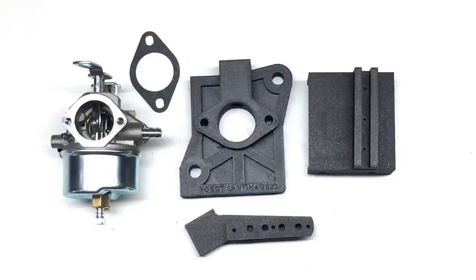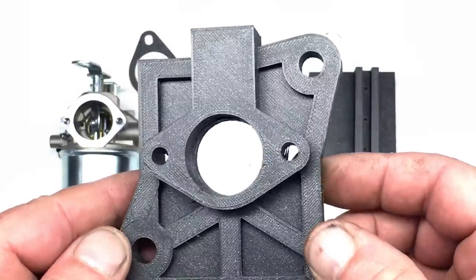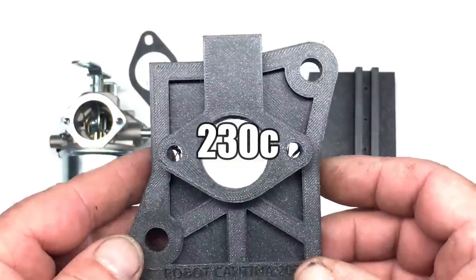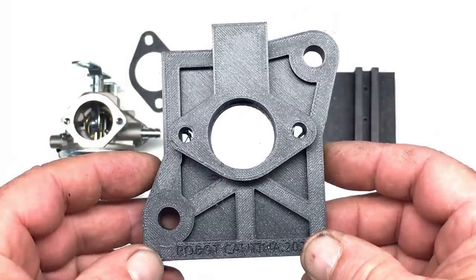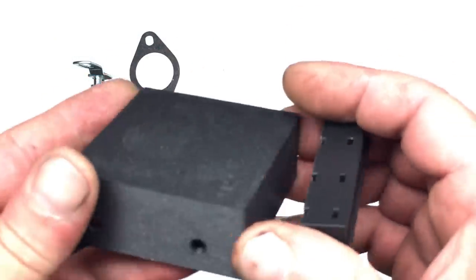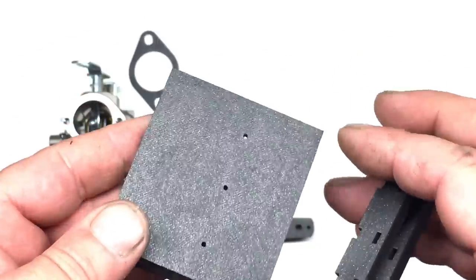It'll work, but it's not the best we can do. So this is obviously the carburetor adapter, and the ASA plastic it was printed in has a melting point close to 450 degrees Fahrenheit, so it should be a lot gooder than the previous adapter. Now we made this thingy to reroute throttle cables so it will line up with the carburetor. It'll mount on the brake master cylinder, and well, it'll work.